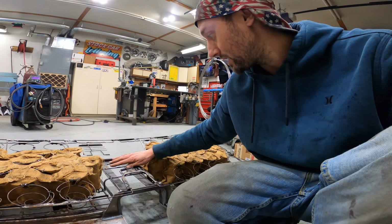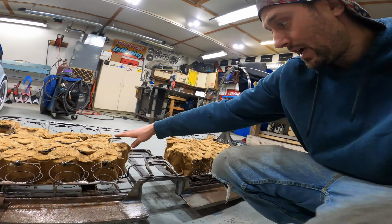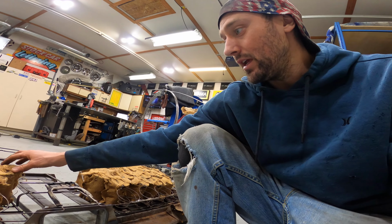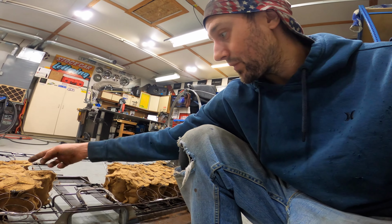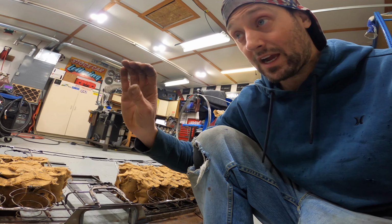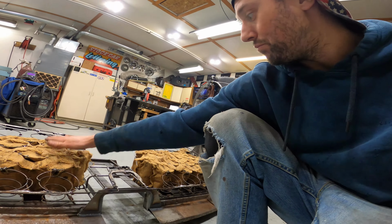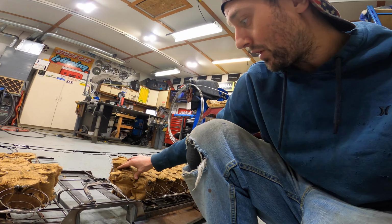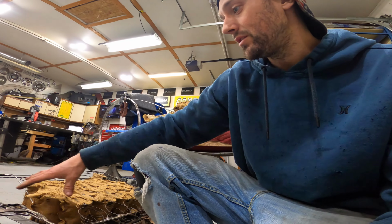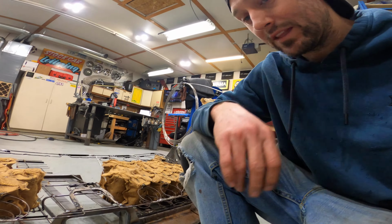But as we come back, there's less and less room. So I will have to possibly modify these springs. I'm thinking it might just be as easy as taking some stainless steel wire and in 3 or 4 spots just looping the wire on the spring and shortening it to the length it needs to be for the maximum length, so it's not adding any kind of preload. Like I said, I don't want anything to be bulging up here because of the springs, but these springs are also really easy to compress. So we'll see. I'll get everything in there individually, get it clipped back in and hog ringed in as I go, and then make the decision at that time.